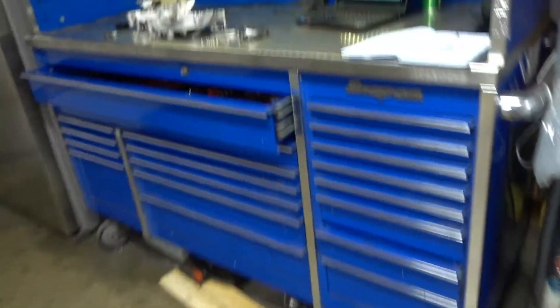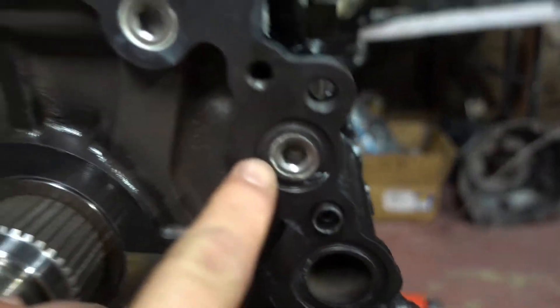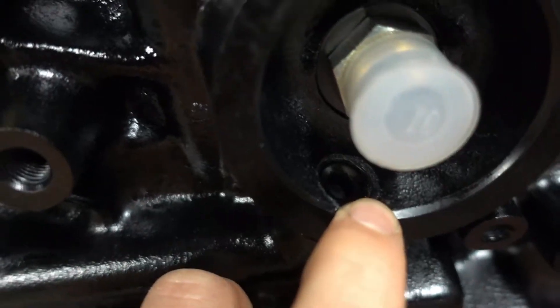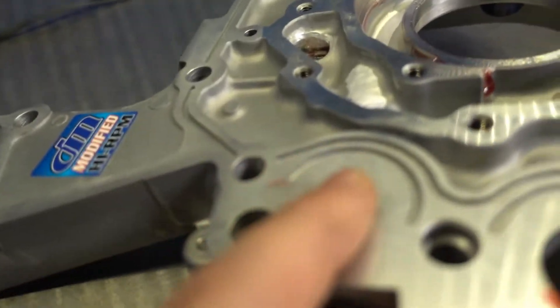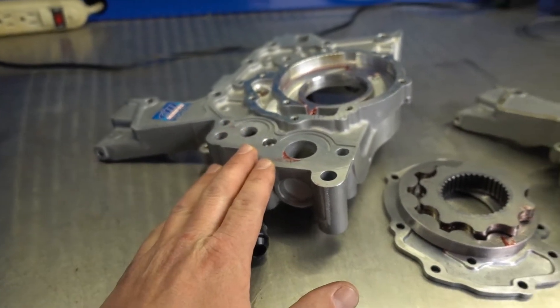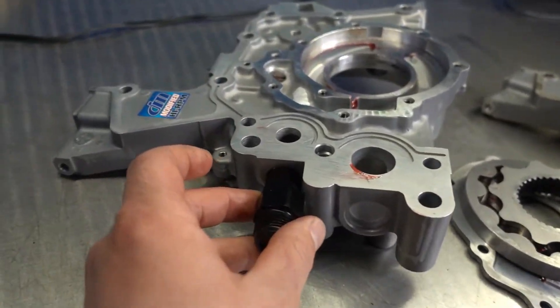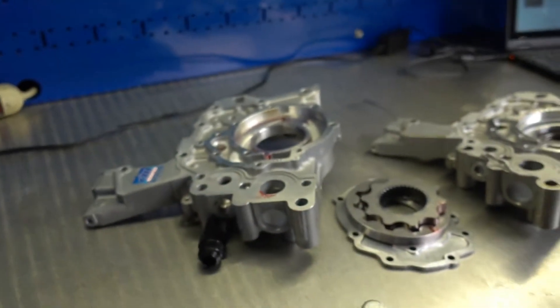What I did — as you can see, I didn't get that version since this isn't capped off. When I had the motor at the machine shop getting rebuilt, I actually told them to cap it off on the block, which is just as effective. They put a cap here and a cap here, so I just went that route. You can totally go with the Drift Motion route and get the fittings from them and they will cap this off for you. One thing you do have to know if you go with the race version: if you are running an AC pump, you will no longer be able to use it because the AC pump sits right here and this will just not work for you. Obviously if you're getting a race version you don't have an AC pump — it's a race car.